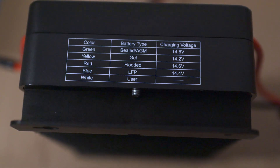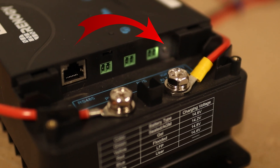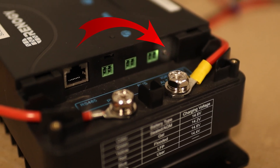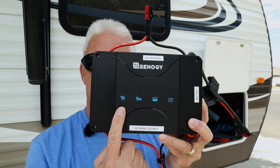I have all those accessories but don't really have a need for them. The charger has the capability to do multiple chemistries — lead acid batteries, AGM, and of course lithium. There's even a custom mode where you can set your own battery parameters. The power input sources for this controller include an external source meant for an alternator that provides 13.8 volts consistently, which will trigger the charge cycle on that part of the device.